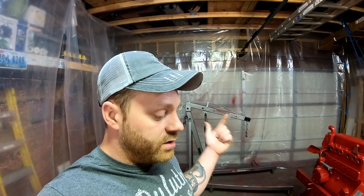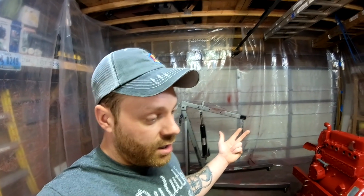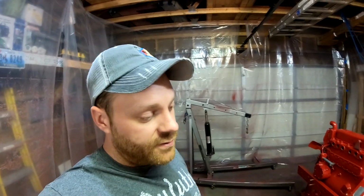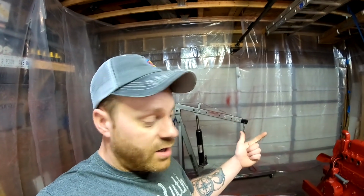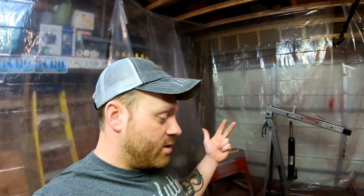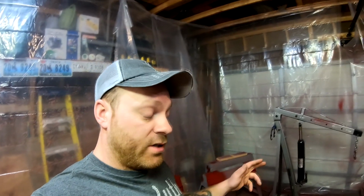And then I also wanted to get the brake drum covers on, and the brake bands and actuating levers and all that is going to have to be installed in the covers prior to putting them on. So belt pulley, brake bands and covers, front engine mount blocks, and I don't think we're going to get the front bolster in the frame rails. Maybe, but don't count your chickens.